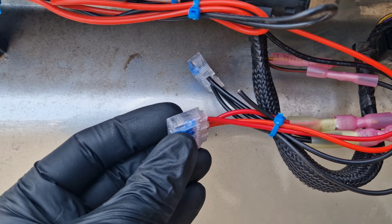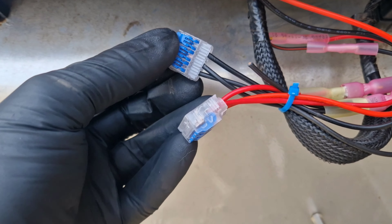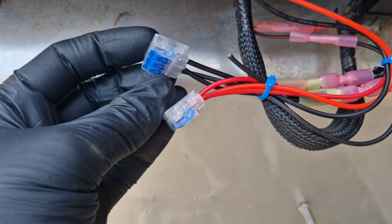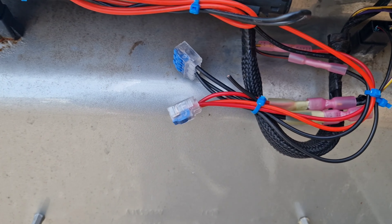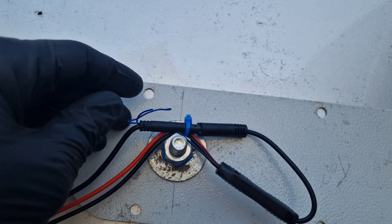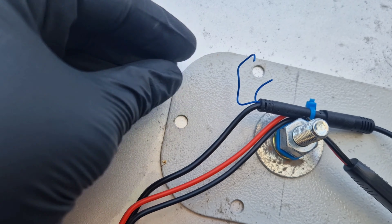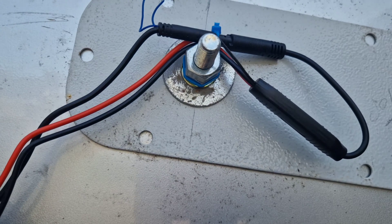The wiring's all nice and tidied up. I've used these wiring connectors — I've used them on the boat, they're rated up to 240 volts, I really like them, they're quite secure and I can disconnect them if I need to. I may choose to wire up to a permanent switch at some point once all the electrics are in. It's nice and tidy — I've fed the wires through the body of the door. This top bit here I cut because it can be used as a front camera and was mirrored, so I've cut it so I haven't got the mirroring on screen. I've also held the aerial up out of the way here so it doesn't fall down and cause issues picking up the signal.